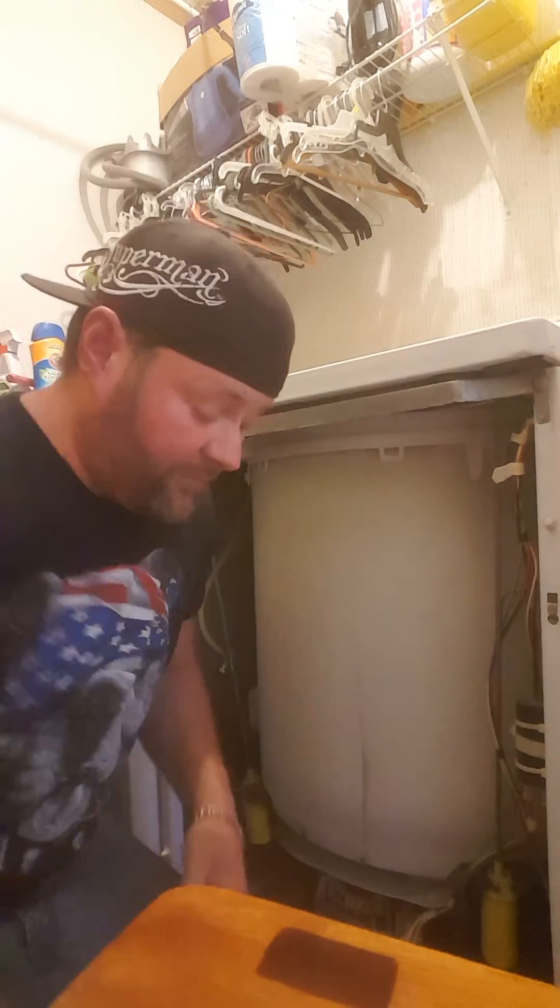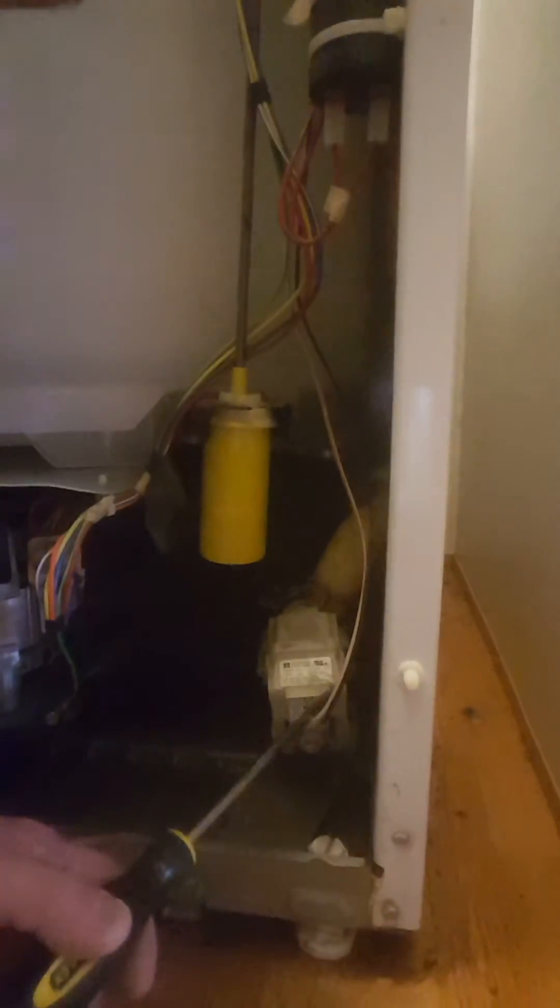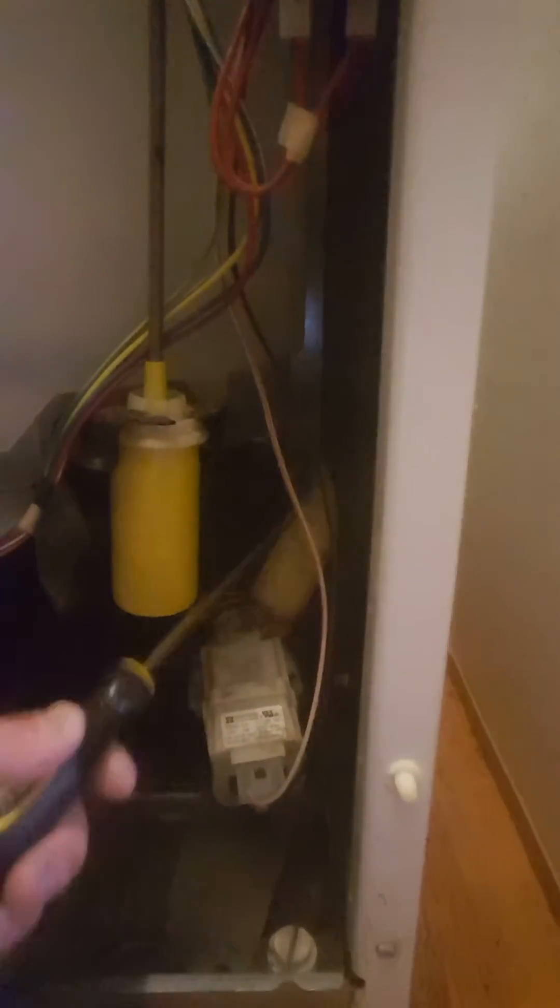After the door's off, it's real simple to get into your water pump. Make sure you're unplugged first just to be safe. This little guy right here is the water pump. There's two hoses, one on the top, one on the front. A pair of pliers will pinch this clamp and you can lift it up and that hose pops off. Same with the one on the front.